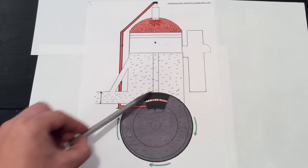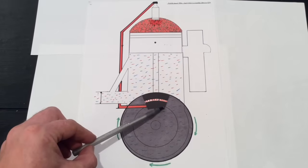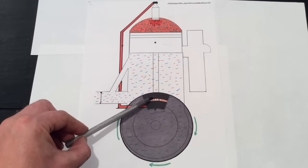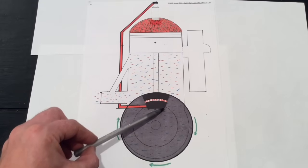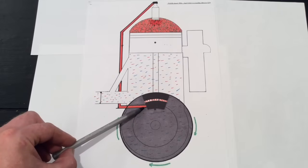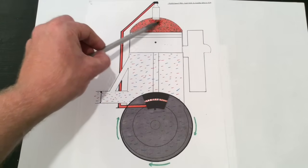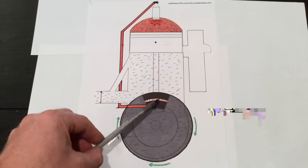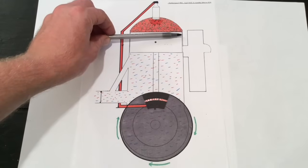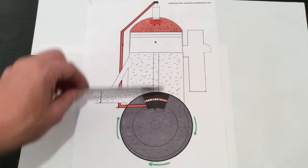What happens is, as the flywheel turns, this magnet passes over the coil pack. The coil pack is stationary, because it is bolted to the engine. And as the magnet passes over it, it transfers magnetic energy into the coil pack. And that creates the electricity, which then is transferred through this special lead, up to the spark plug, where it can be used as a spark. And the coil pack is set just in the right place, so that when the magnet passes over it, the piston is in just the right place there, where it's compressed everything together — the air and fuel mixture — and it's ready to be sparked.